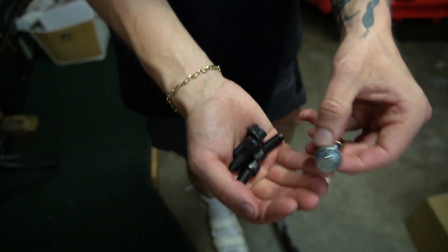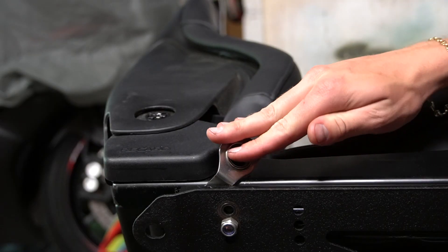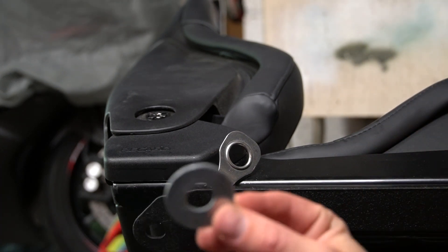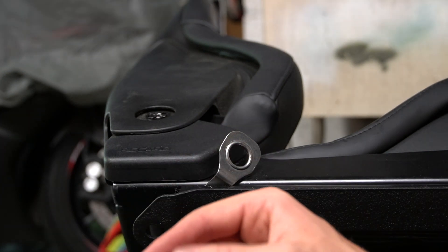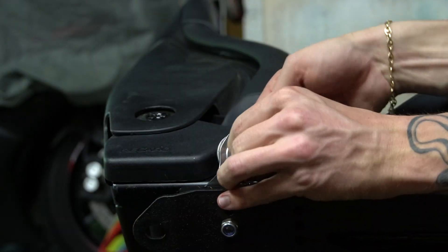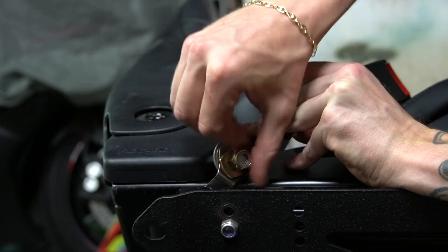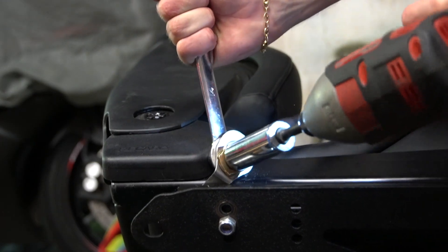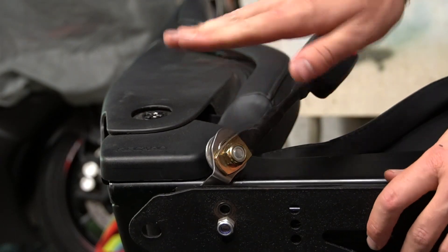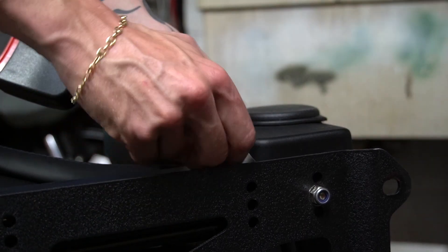And then we got a nut and a locking nut combo for the seatbelts, so I don't even have to weld anything or get anything welded. This is a washer from the pack that I put the Skyline on — same washer. We're going to pop it through that, and then we have our locking nut. Put our bolt through here, slide our washer over the back. Slip over the seatbelt receptor to finish off the metal sandwich, and we have the locking nut. That is solid.